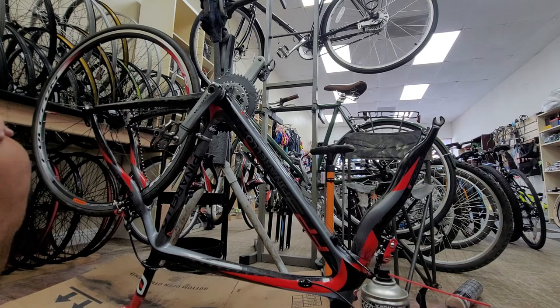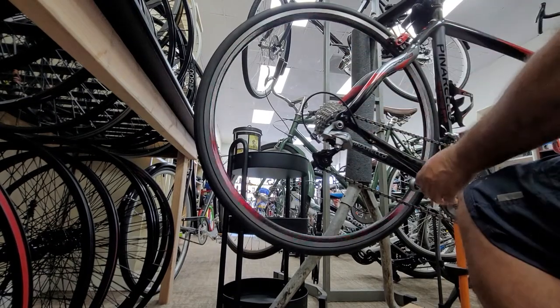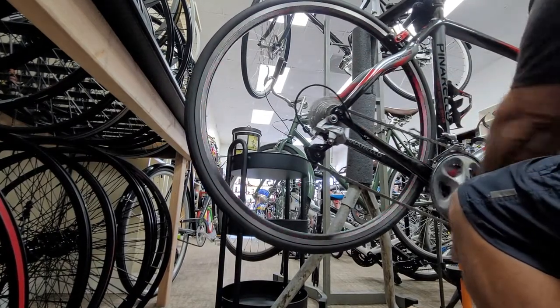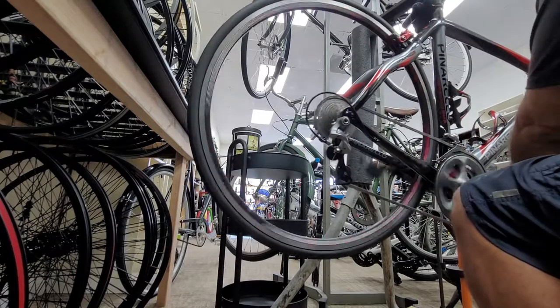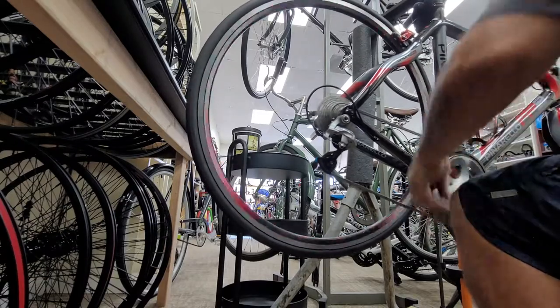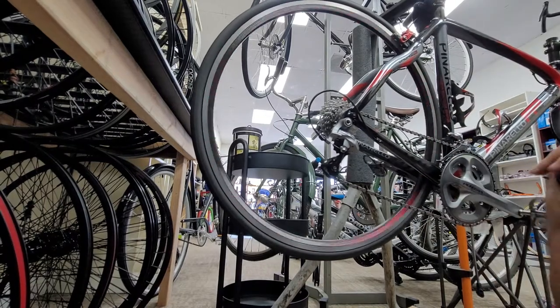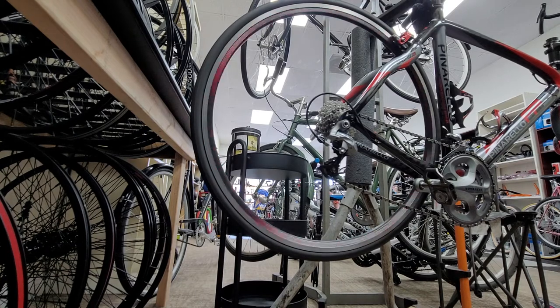We're going to finish next. We're going to put on the chain and check all the gears, how it's working. After we adjust the derailleur, the tension, the angle, we straighten the hanger because it wasn't straight. And now we got this beautiful result. Now we're going to add a little more oil, no more, to the chain and see how it performs.